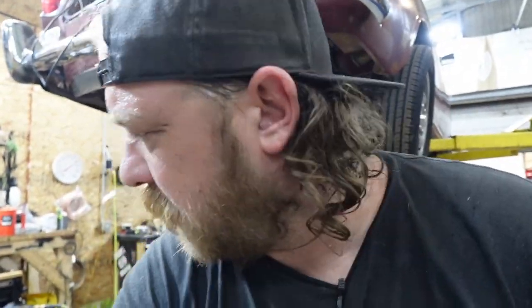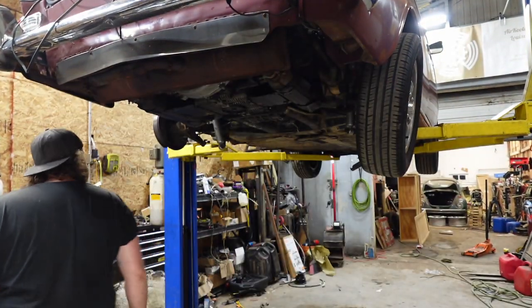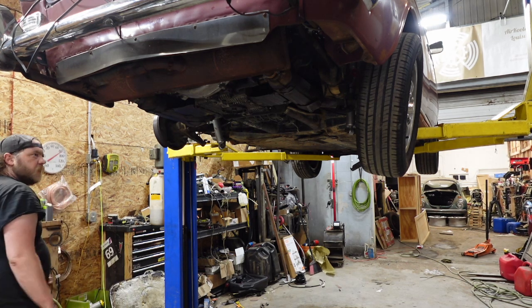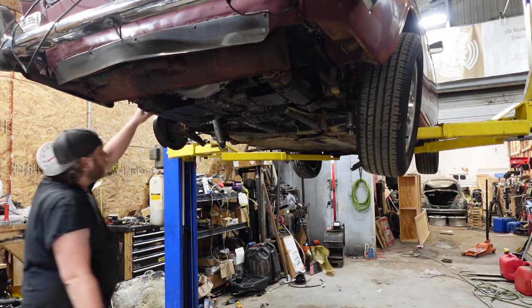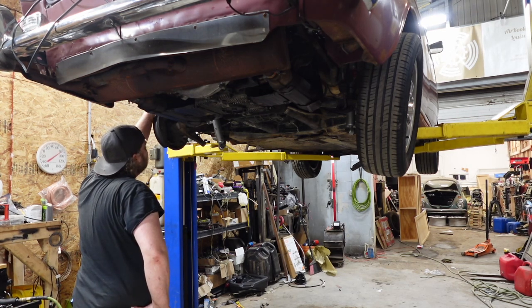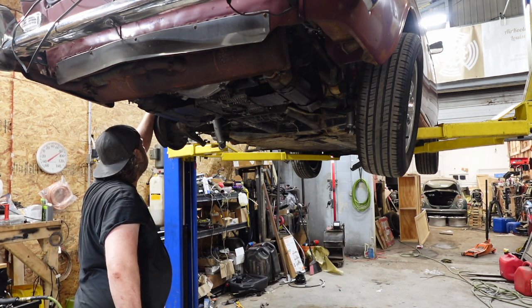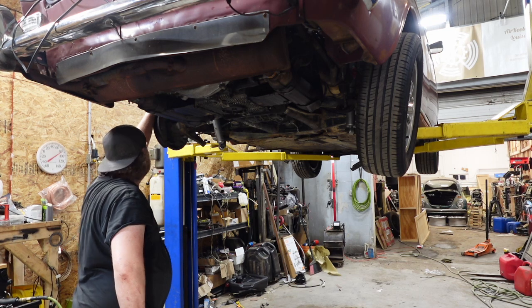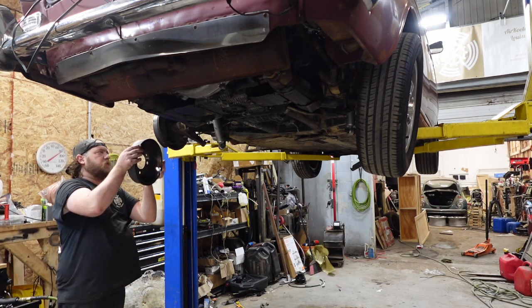So, as always, I'll make recommendations. And it's just a recommendation, the thing's fine. It's not the end of the world scenario. Where was I? Wheel cylinder? I mean, it was bleeding. Are you gonna leak still? I don't know if you could tell, but it was wet back here. I'll leave it open because it'll probably gravity bleed. All this can go back together.